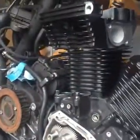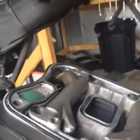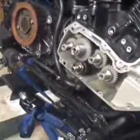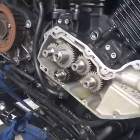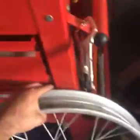But I didn't go with the roller rockers, like I said. These are just flat rocker arms, and they push down right on the top of the valve spring. Roller rockers, it's less friction, get a little more, but for the money, not really worth it. I've got, like I said, the N4 high lift cams from Andrews, port and polish stage 2 light heads, and got some more parts over here. Let's move this out of the way. Take these out in the light so we can see what we got here. Again, this will be all for another day.